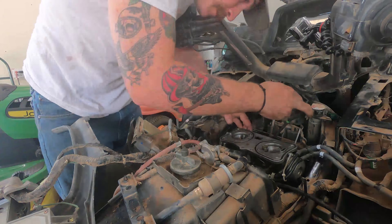I just used a shop vac to vacuum out any dirt or debris that might be in the area — I don't want to knock any of that into the engine. What I did is I sprayed white lithium grease on the carb boots themselves; that's just a little trick I learned that'll help them seat up right. Now I'm putting on the throttle cables under the throttle plate.